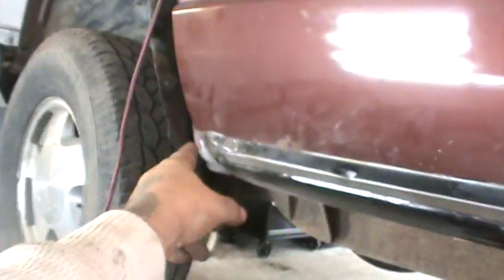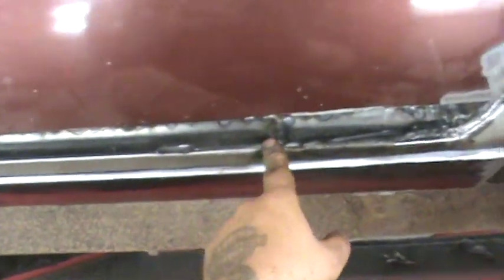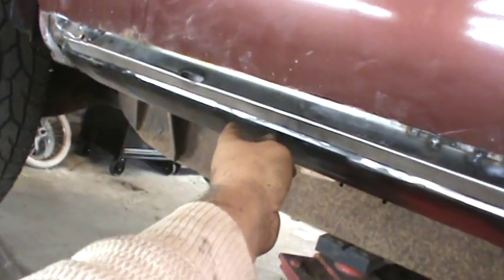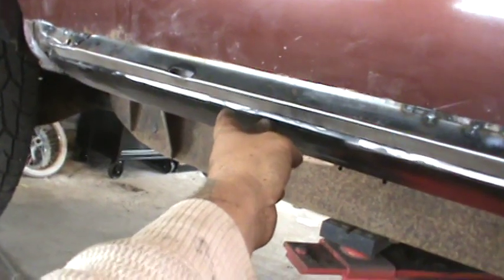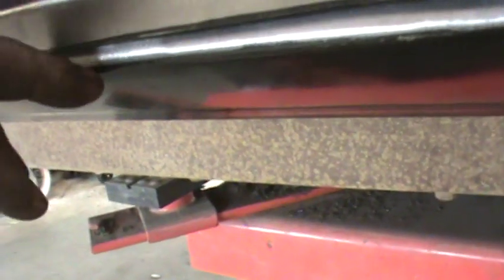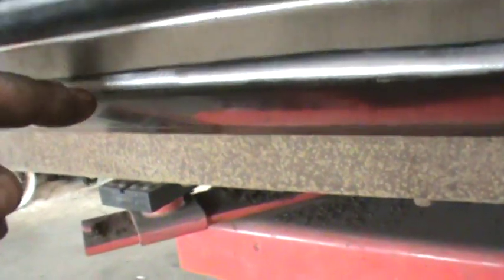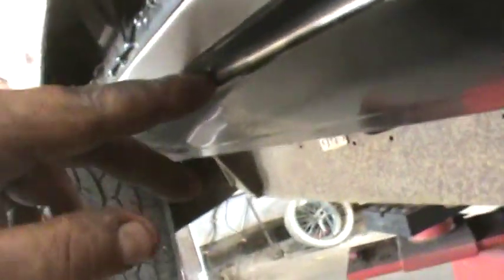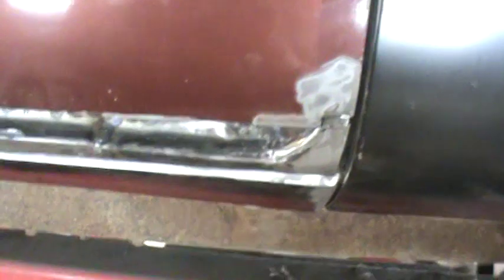Because I went from there to here — three feet — so I'm going to go from here to three feet, but I'm not going to weld it solid because I'm doing it in two sections. I need to make sure it's even down low so when I do this door skin it meets right to the bottom of the rocker — not higher, not lower. Proper fitting is right at the edge.